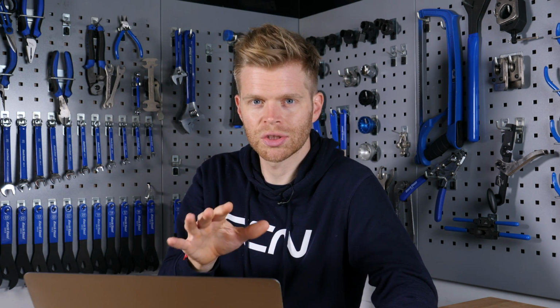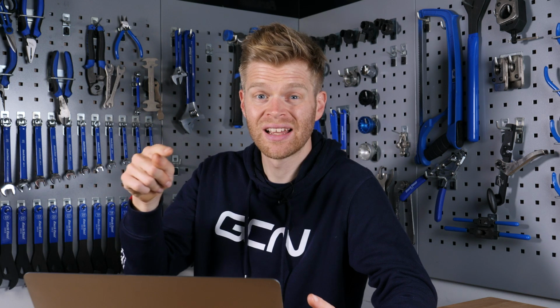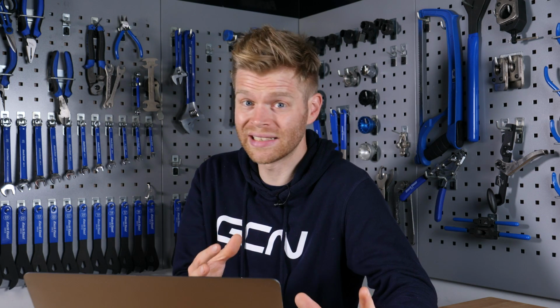Personally, I'd love to try shorter cranks on a TT bike. I've got a TT bike challenge coming up and I'm actually thinking about trying shorter cranks for it, something like 165s. In the past, I've used 172.5s and gone up to 175s. And I found that 2.5mm difference, I too noticed a big drop off. I found it really difficult.